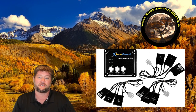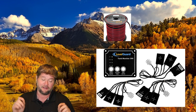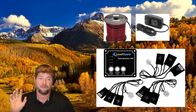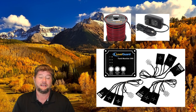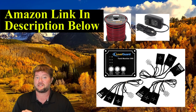I'm going to tell you two things you need to know if you're interested in buying one of these. Number one: it does not come with a wire to run from the tank to the monitor panel. It has a little wiring harness, the sensors, and that's it — so you have to buy your own wire. It recommends 12 gauge; I bought 100 feet off Amazon. The second thing is it requires a 12 volt power supply for the control panel. In an RV that's no big deal — hook into the battery. But for a residential setup, you need to create 12 volt power at at least one amp. I bought a little adapter off Amazon for about seven bucks that produces 12 volts at two amps — I cut the end off and we're good to go. I'll put links to all three of these things in the description below.